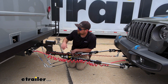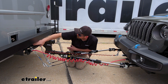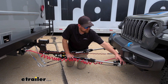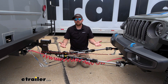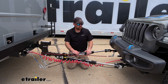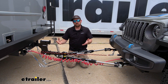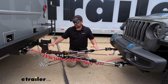To figure out if you need a drop, pull your setup up close on flat ground, measure from the motorhome's hitch pin hole down to the ground, then measure from your vehicle's base plate pin hole down to the ground. You want that distance to be within three inches of each other — the closer, the better. For example, if the motorhome was five inches taller than your vehicle, a four-inch drop would be appropriate, setting them within only one inch so the tow bar is level.